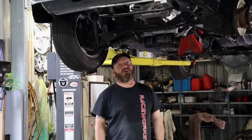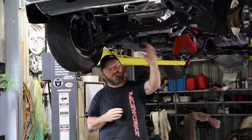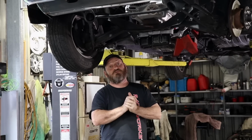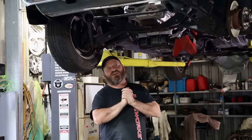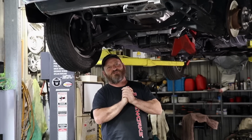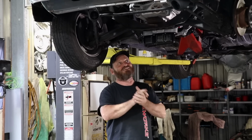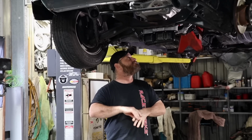So, in the meantime, I'm going to pull the engine back out and put it back on the stand, and I've got to make a power steering air conditioning bracket for it. Since it's got aircon, we may as well utilise it. I'll negotiate with Gav about whether it has a heater, but I'm pretty sure it's not going to because there aren't any heater lines left on the engine. It's all AN fittings now, so that's one thing we don't have to worry about.